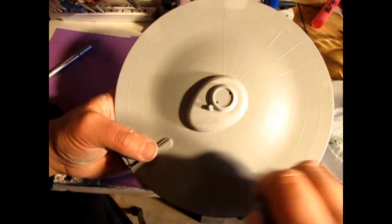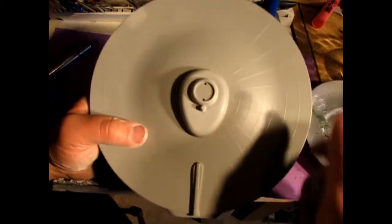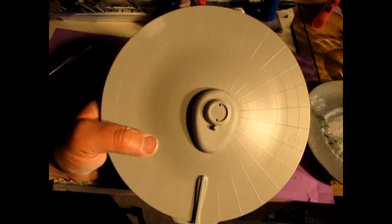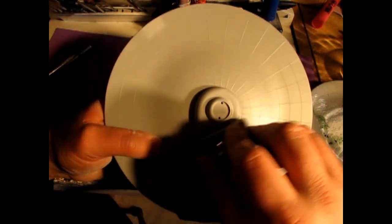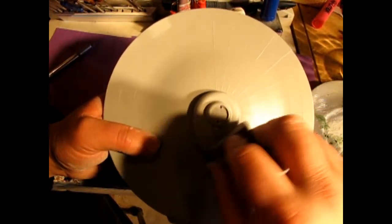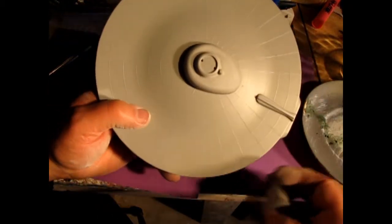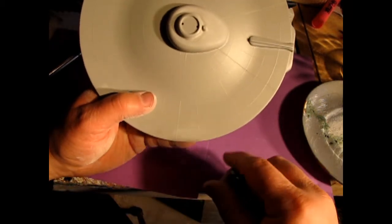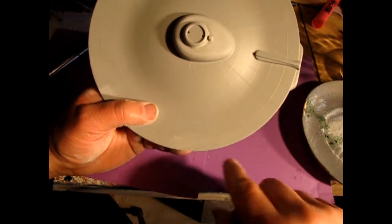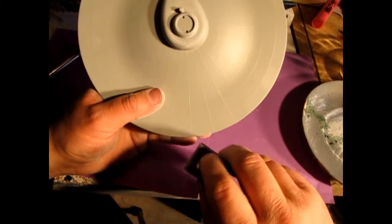And you notice how I'm dry sanding this. You could also wet sand it. Although what I think is happening is because that primer, or the plastic fill, is water-based, I think I'm actually causing it to shrink a little bit when I do wash off the dust. So that could be a reason why the divots are still kind of there. Yeah, that grid line feels low.